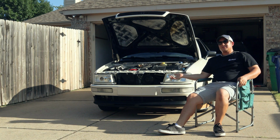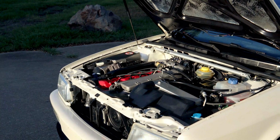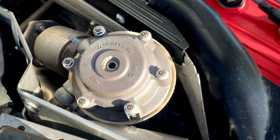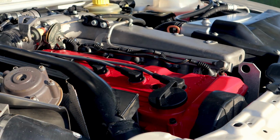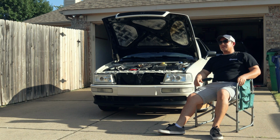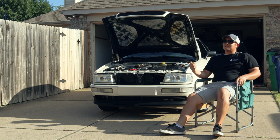I'm Matt Brandner. This is my 1990 Coupe Quattro engine swap. It has a 3B out of a 200 Avant. It's a 5-cylinder turbo engine, 20 valve 5-cylinder. Started its life out of a 200 wagon like the one I have in the back. These came with a different 5-cylinder, a very weak 7A, which is another 5-cylinder, naturally aspirated.